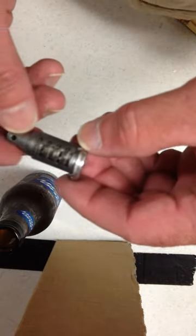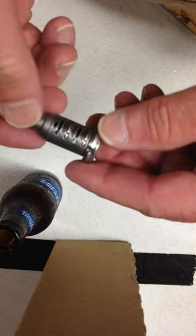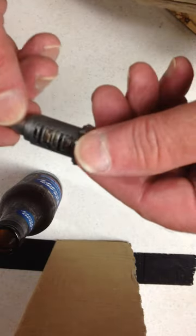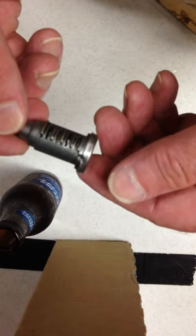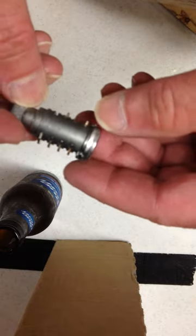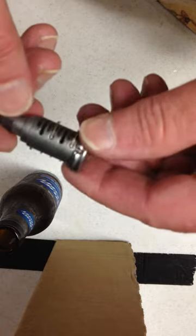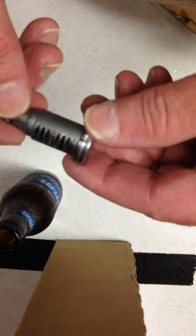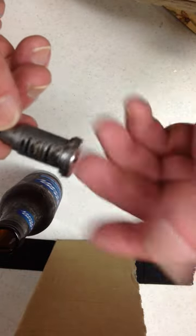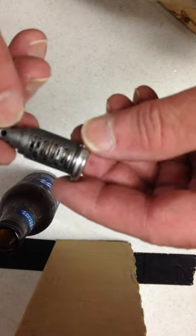This one, if you look at it very closely, you'll see that it's missing a leaf. The reason it's missing a leaf is because I'm going to show you how to reuse and re-key these with the existing number of leafs that they come with. You can go and buy these things for about thirty-five or forty dollars a piece and key it yourself, but what I wanted to do was reuse these, key them to the bike I'm putting them on — basically taking a set of bags from one bike and transferring them to another without buying a new set of locks.